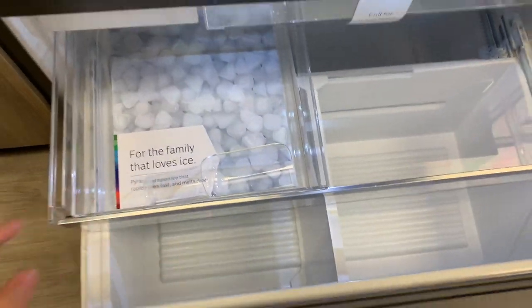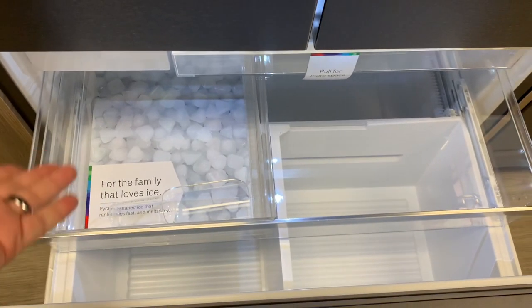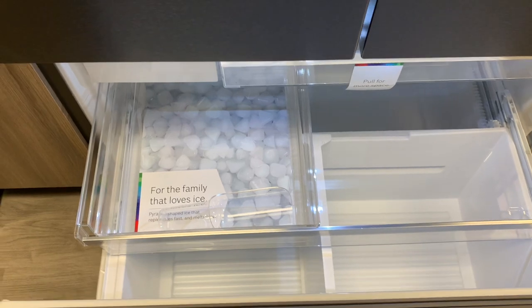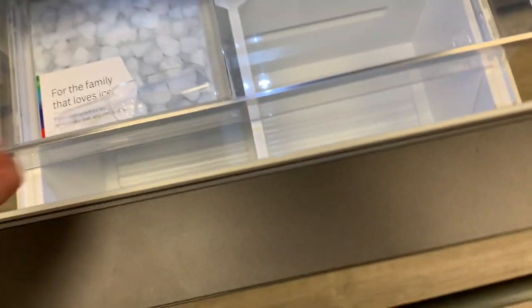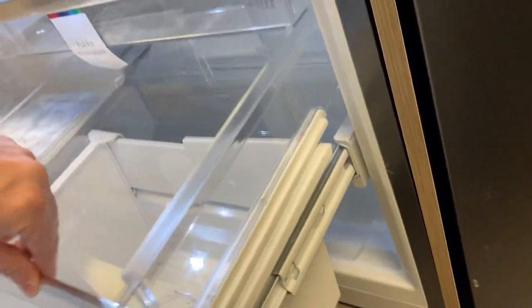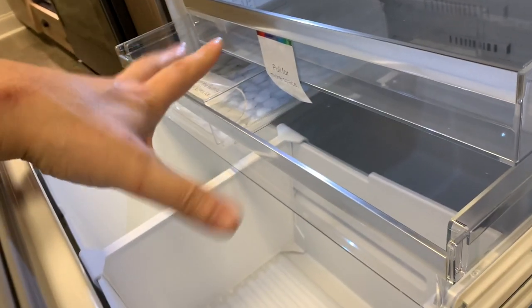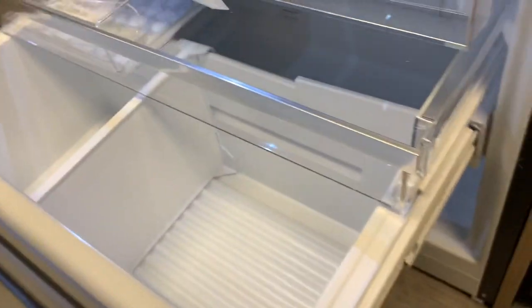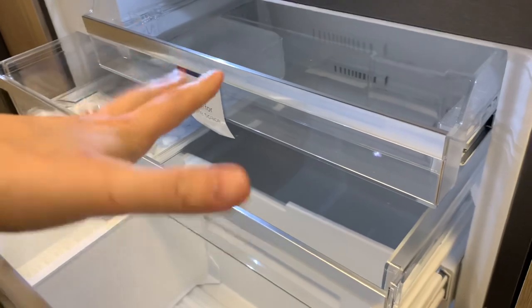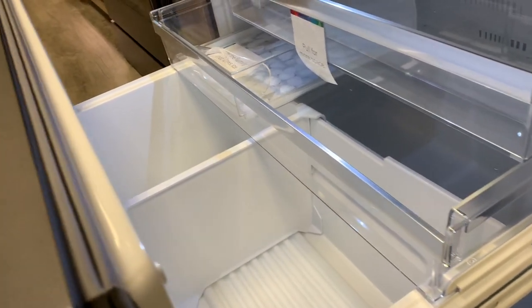There's a picture showing what the ice looks like — nice opaque ice. Get yourself a clear ice machine if you can afford it, but this thing looks like it makes a lot of ice. A big issue many European manufacturers have had in the U.S. is that they don't make a ton of ice and the cubes are kind of small, so it looks like Bosch has made it hold more ice. The freezer drawer is on nylon runners, the upper basket is on metal tracks, and the main assembly is on metal tracks like most refrigerators. It all feels reasonably well made — not super chintzy. You've got a little divider that slides left and right, tight tolerances, not a lot of wobbliness. Comparing it to a comparable GE, LG, or Samsung product, this appears reasonably well made.